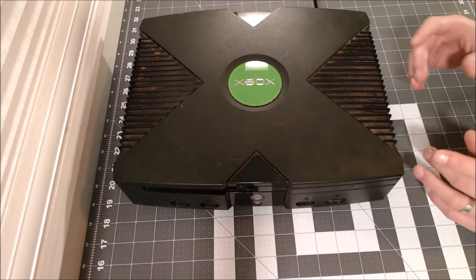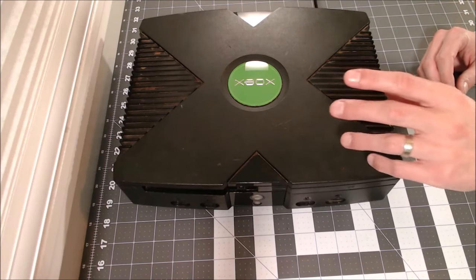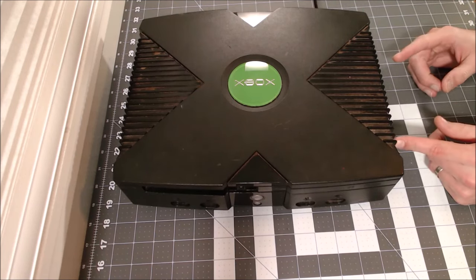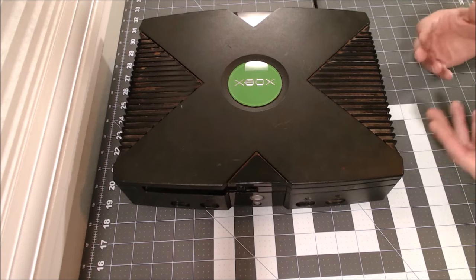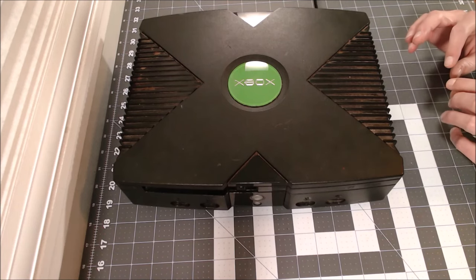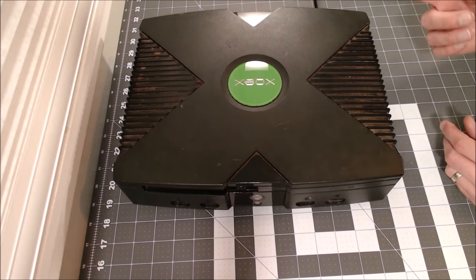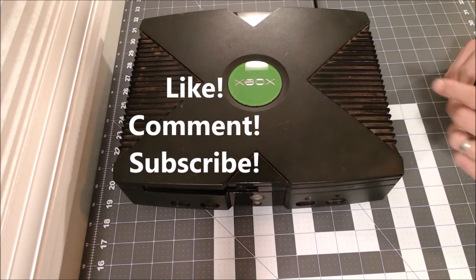With this one it really didn't come down to dirt and dust being the primary issue like it so often is. Instead it was just a worn-out belt, and it seems to be maybe a design issue that the magnet is so strong that it causes the belt to wear out faster than it should. Replacing that belt is a fine option — perhaps the best option — but the fix we implemented here was simply spacing apart those two pieces so that the magnet force was reduced such that the current belt, even in its stretched-out state, is strong enough to open it. The fact that it did work with the disc in just tells me the disc itself was acting as that spacer. In any case, the Xbox is good now, and we can finally take our games out without having to leave a dummy disc in just so the thing can open. I hope this ends up being helpful to someone out there with a similar issue. Long live the Xbox — anywho, thanks for watching.